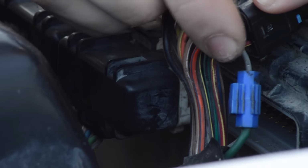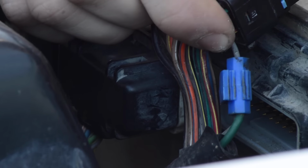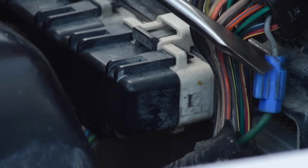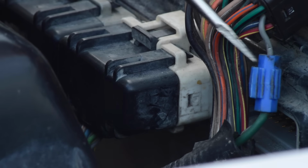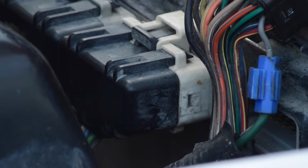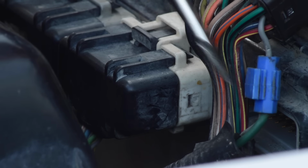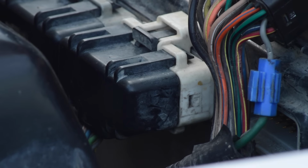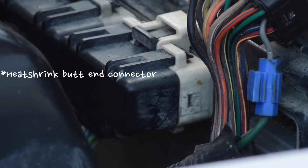And this gray wire is what you need to ground out. That grounding out is what's going to give you your extended idle. Now you can see here, I used a simple splice-in connector. You can use whatever you want, but this is pretty common that most people have at their house, so it'll do the job just fine. Although it's not probably the best waterproof solution in the world, if you wanted to use one of those waterproof connectors that you just use and splice two together, that would probably be the best option. I'm all sorts of evil and use that, but that's fine.